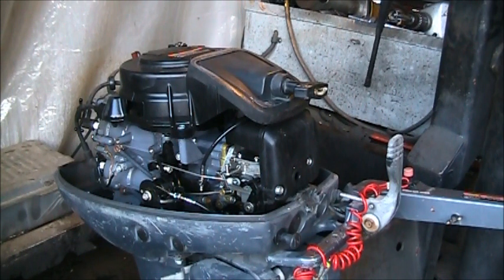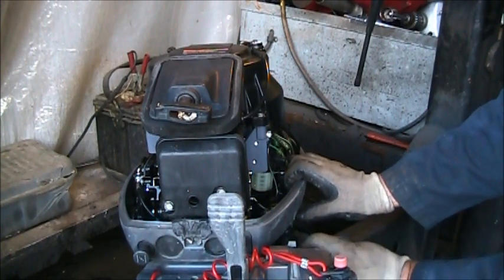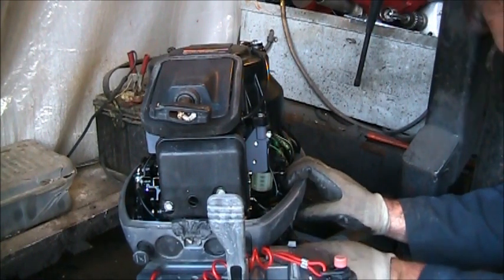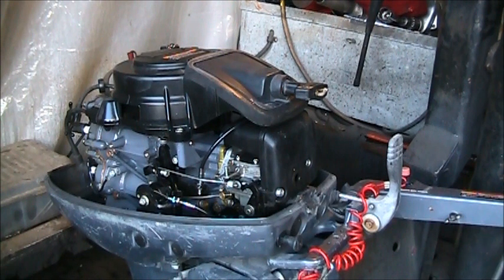Okay, got to find me a Yamaha fitting. Got this thing so tucked under here. And you know what it says right on the side? It says 100 to 1. Yeah, they put that mix, 100 to 1. And that little sticker, Evinrude did it, all the two-strokers did it, immediately cut their emissions by 50%. Sure did. And it immediately cut the engine life on many of these motors in half as well.